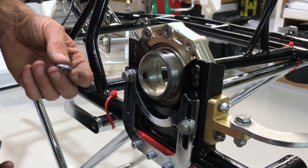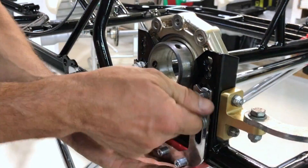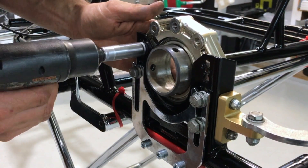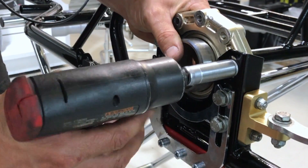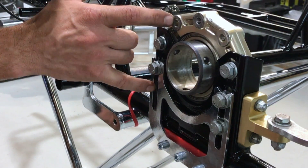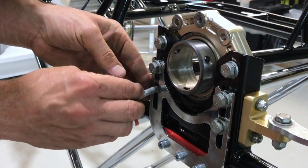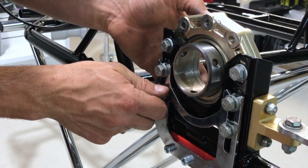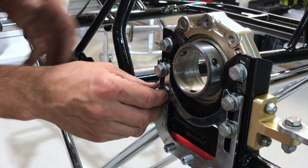Then you can get your other bolts ready. Next up, install the rest of the hardware. You'll notice that these two bolts here have been left open. I'll install this one now before I do all the rest up, so I can get that washer in. We bolt the brake caliper through these two, so we want to make sure that when we lock all this off, we can still get a bolt in through that washer.